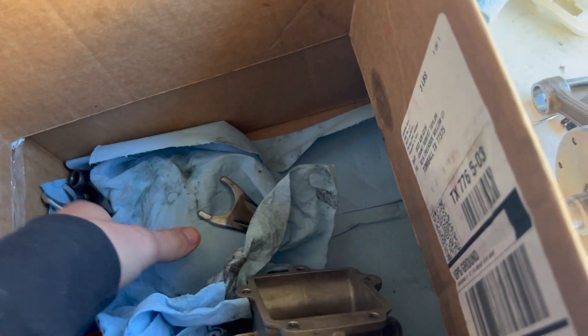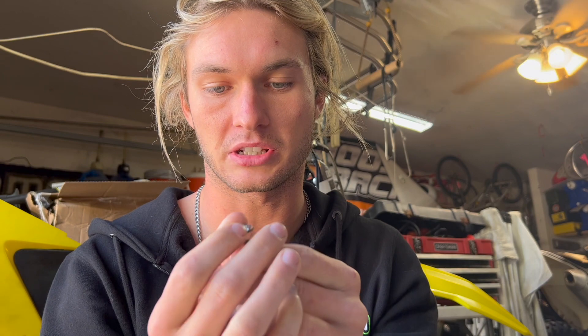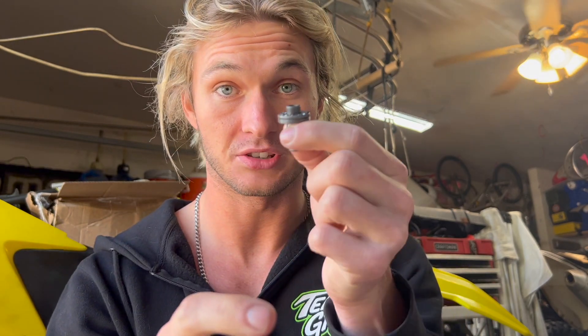I want to give an update on something I said earlier — about the roller bearing being missing a washer. Well, on this bike the roller bearing was literally just upside-down. When it's upside-down like that, there's nothing preventing the bearings from rubbing against each other — added friction, steel against aluminum, which you don't want. The steel bearing is supposed to be riding on the other piece of steel. With it upside-down, these bearings are rolling directly into the aluminum, which literally could have caused the motor to seize over time, spread metallic material throughout the motor, and trashed other gears. So it wasn't missing anything — it was just installed upside-down. If you have one of these bikes, just orient it correctly and you're good.